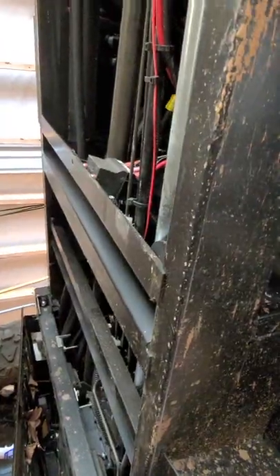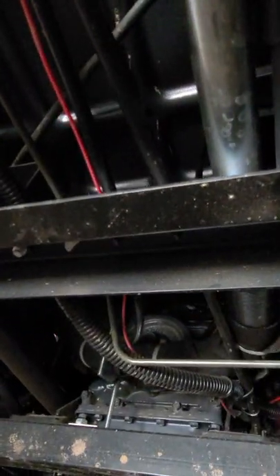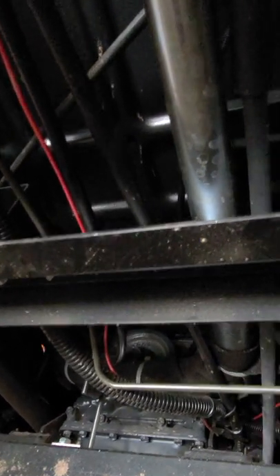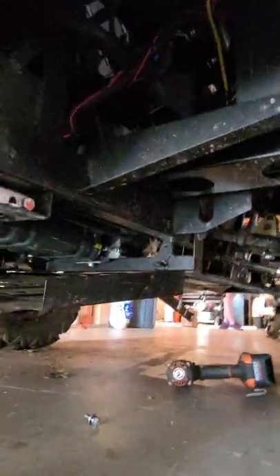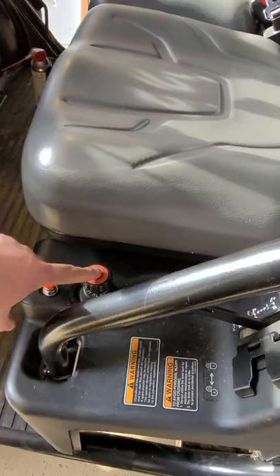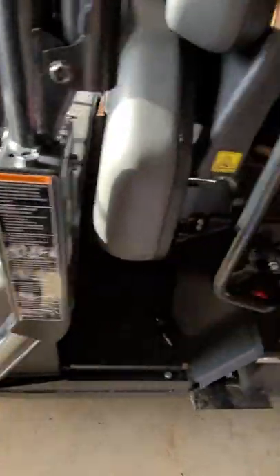This is the way you want to route it. You can see under here — here's the cable. Make sure it's on top of all the other pieces. Route it over the coolant hoses. I found that if you just push it through, it kind of just feeds itself where it needs to go. You can come back later and do all your zip ties. I actually waited to put this in here until after I was done routing the cable.